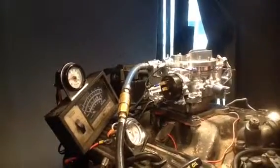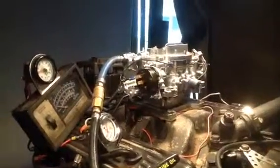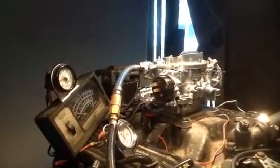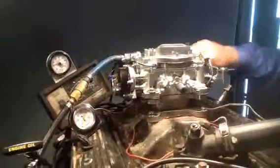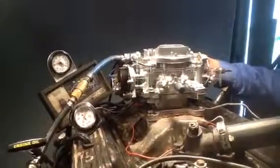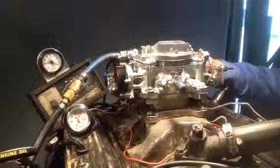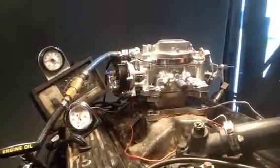You can see how sweet it is — all metal, none of that plastic stuff in them thermal quads. All replaceable parts — any part inside that carburetor right there is Edelbrock. You can just go to the Edelbrock website or go to your local auto parts store, any part inside that carburetor — Edelbrock will fit: gaskets, venturi, butterflies, everything else. This casting here is made by Weber. This is a beautiful thermal quad replacement for your Mopars — Chrysler, Dodge, Plymouth. Happy motoring ahead.